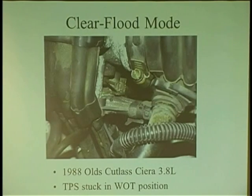So you may have, in fact, a possible problem where the potentiometer could be stuck in one spot. Computers will command, let's say, an AC door to open with the motor, and the motor's trying to work it, but the door is getting stuck. It'll actually hold back on the current, saying, I don't see movement, so I'm going to pull away that driver and stop moving that door, and then it'll set a code. So the sensor is watching the activity of the motor. Or what if the sensor's not working, and you hear the motor working and you see the door moving? You need to understand how these sensors work.